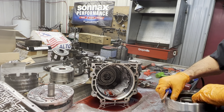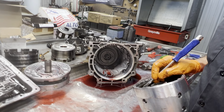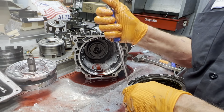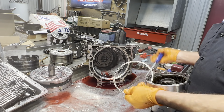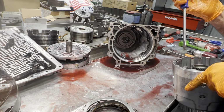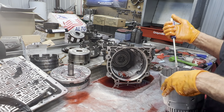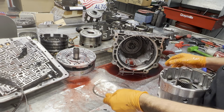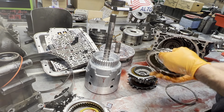And we do have no load springs in here at all. We have 6 clutches, which you can start to see a little bit of wear on the tips right here. See it wearing? A lot of times when you see stuff like that, you start seeing band to clutch timing off. In other words, bind-ups and stuff like that. In other words, the clutch coming on before the band's off. Anytime we put that big band in there, you have to remember you're putting more surface area that has to be released. So now you also put 14 clutches in here.